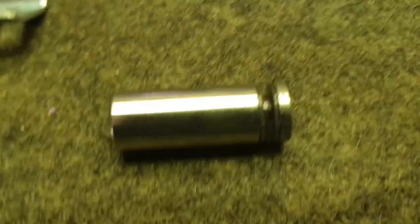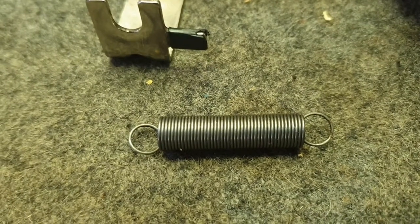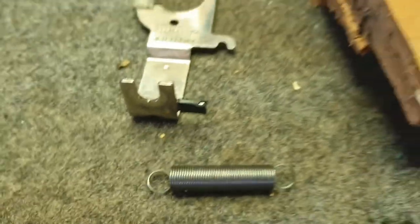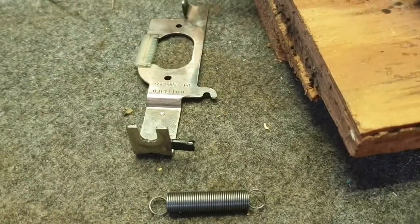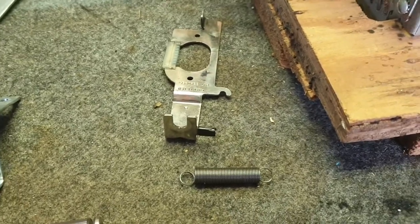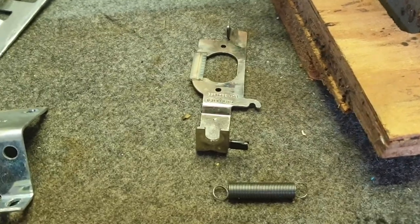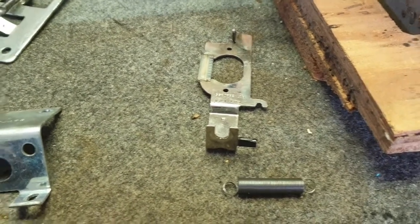This plunger is one of those that has an insert in it. Not all of them do, but you can get a lot of problems if that insert's not there. There's the spring — we've cut a couple of rungs off it, which we always do. These springs, watch this machine is about '73, so 47 years' worth of tension — they lose elasticity. Cutting a couple of rungs off does not hurt. I've worked with springs personally for over 50 years, and in the old typewriter game we did that regularly, re-looping springs and cutting them to strengthen them. But it's no fix for sticky parts — you've got to fix the problem first.